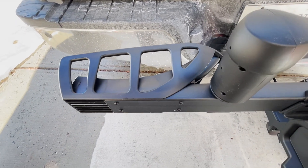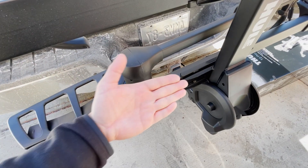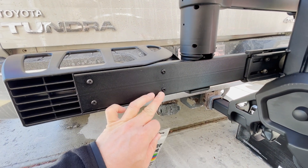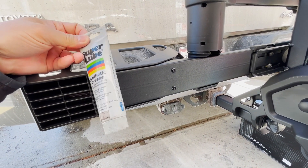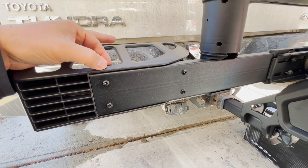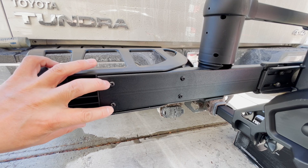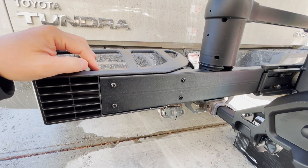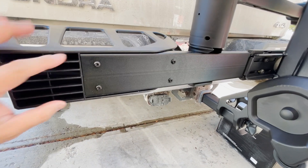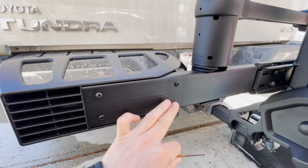The next step is installing the two wheel baskets. The pointed portion of each basket points toward the center of the bike rack. To install, take four coarse-threaded screws from the hardware pack — the smaller ones — and coat them with silicone lubricant. These baskets are made of molded ABS with a threaded shaft that passes through the frame. The silicone lube helps the screws install better and prevents them from rusting inside the ABS years down the road. Tighten each screw with the included Allen key until snug.